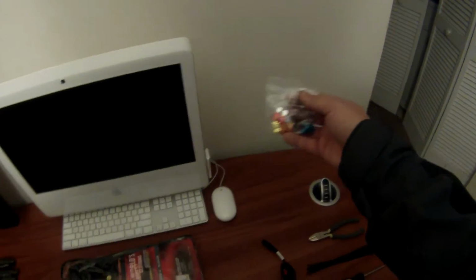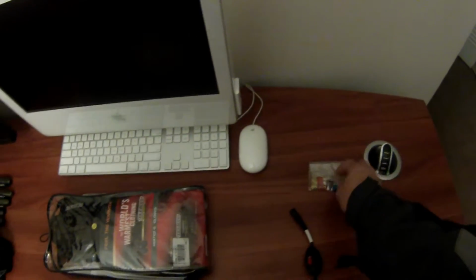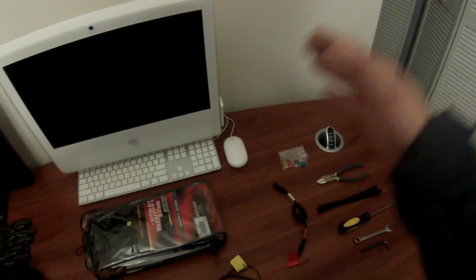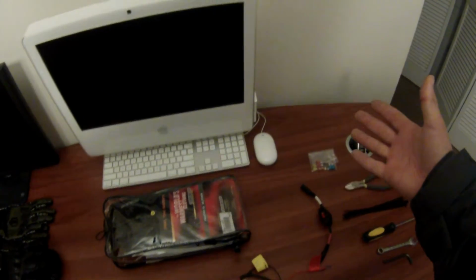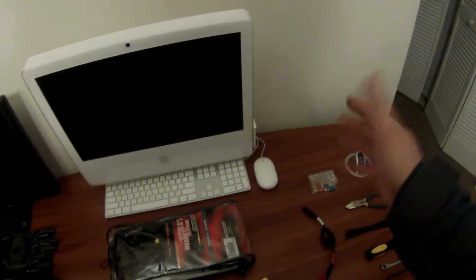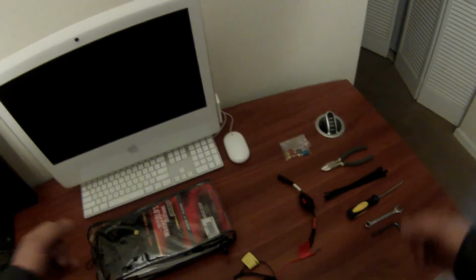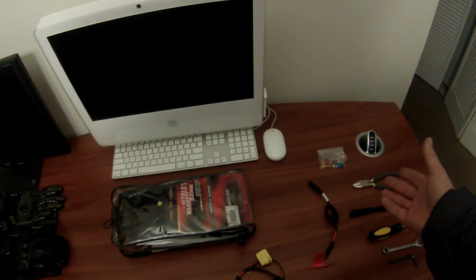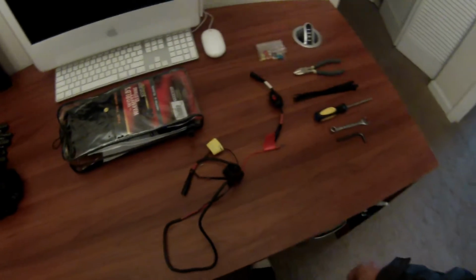If you do use multiple pieces of equipment where you're going to be running your equipment in series, then you would just add the value of the equipment and then go one step up to the next fuse. So the jackets, I believe, are 6.9, so you just say 7. These are 2.2, so 3. So you'd actually use a 10, a number 10 fuse would be sufficient.